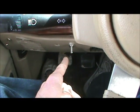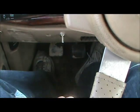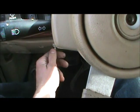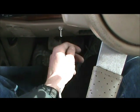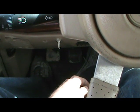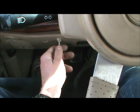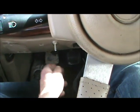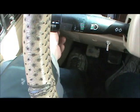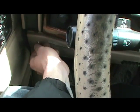This one right here is for the solenoid valves that shut off my fuel going to my engine. Right now it's off. If I turn it on, my car will probably die. Well, it gives it a boost, and then you hear that little boost. Just that teeny little bit really helped out. But yeah, so that'll turn the fuel on and off. This right here will turn fuel on, so it lets fuel go into my vaporizer container. It'll go in pretty fast, so I don't really like messing with that.